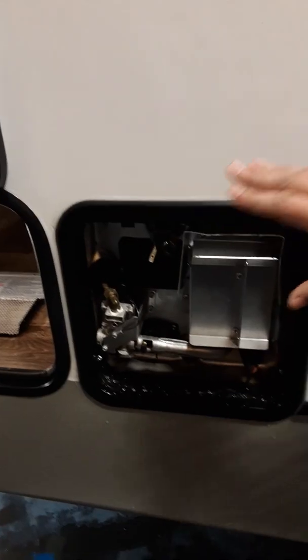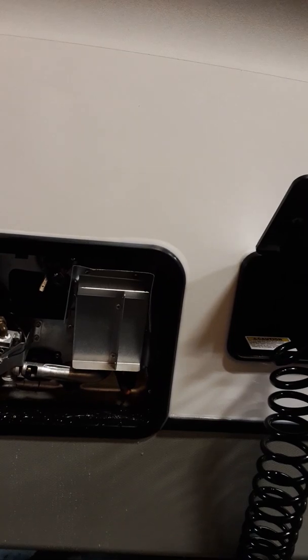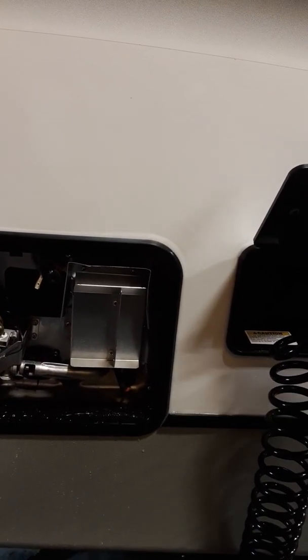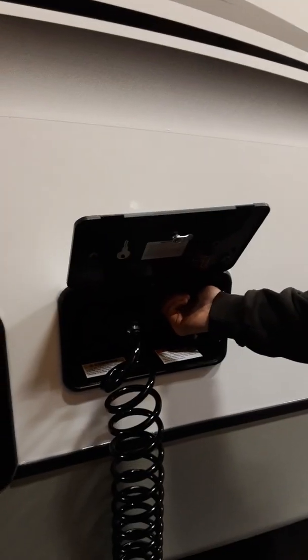So I need to drain the fresh water also. Yep. Remember how I told you, hot water heater and fresh water tank, those are the two you're going to drain out. So there's no water in it. I just turn the knob to drain the fresh water. Yep. But at Colebrook, will I have to drain the fresh water? Will there be any in there? You can decide when we get done if you want fresh water in the tank or not. Fresh water is for your dry camping, and if it's empty, you're going to want to fill it by flipping this over. At Colebrook, you're not going to need that.